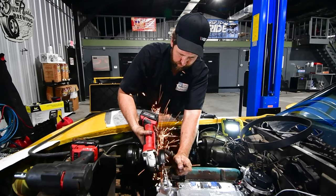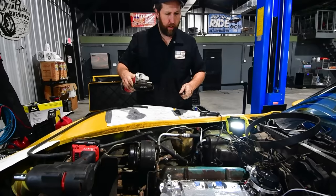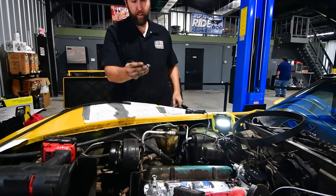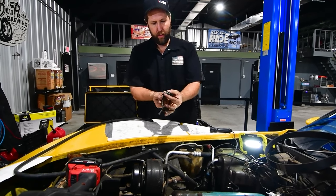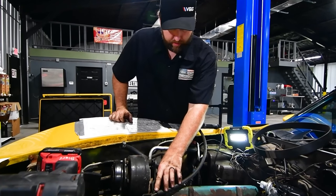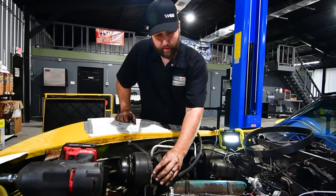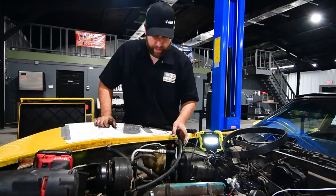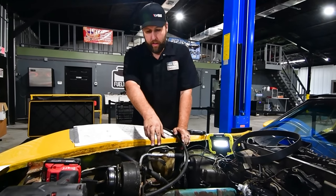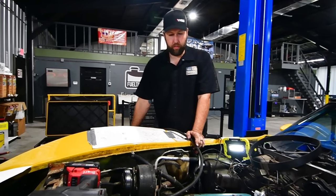Hey, we're not on fire. That's great news. I keep these all the time because they go right in the Q-jets and they're handy to have. I snipped the fuel line off because I got to do that anyway. The carburetor has a fitting that comes forward with the fuel pressure gauge. And I hooked this line up over to this jerry can because I'm about to spin it over. So all the fuel goes into this can over here, that way it's not dumping on the engine.